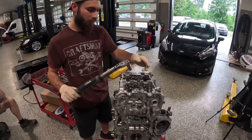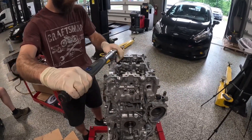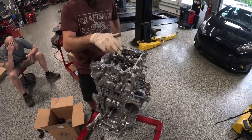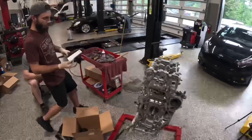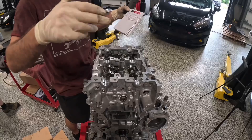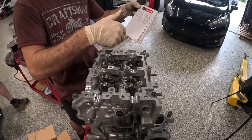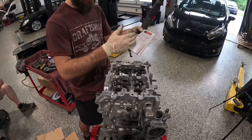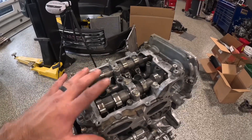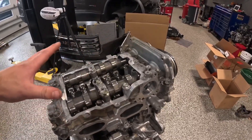I'm installing the lower carrier first, torqued to 14 foot-pounds. I already have the shims installed with the rockers and lifters. I numbered them myself as exhaust one, two, three, four and intake one, two, three, four. These numbers represent the number on the shim I installed so I can keep track. The caps were also torqued to 14 foot-pounds, and make sure you keep the orientation how they came off originally — that's really important.